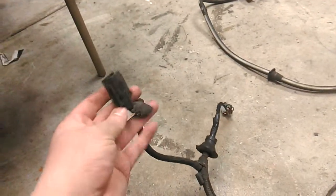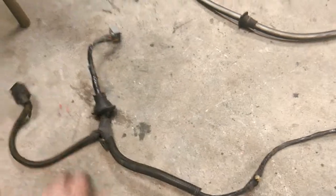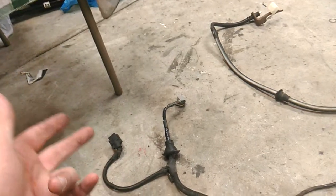This goes down to the speedometer — the mechanical speedometer cable. There's a small electric readout just for this on the cruise control models; it goes in between the traditional speedometer cable and the transmission. So that piece will have to be pulled later.